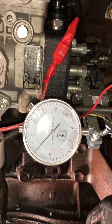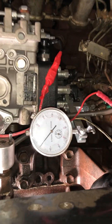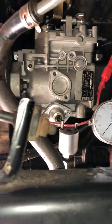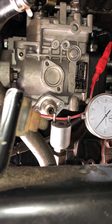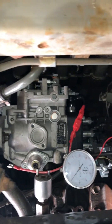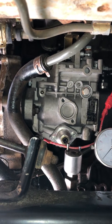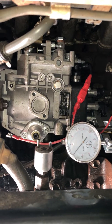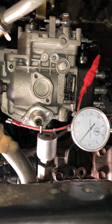So there you have it — just trying to clear up the confusion because I was very confused myself. Videos say top dead center but no one mentions bottom dead center, and it's actually bottom dead center when you're putting the belt on. That's when the little screws face straight up and down, at about 11 o'clock on the bottom pulley. When you're timing the pump — just putting a brand new pump on here — it goes the other way to top dead center. No idea in an engineering sense why top dead center ends up at about 9 o'clock instead of the actual upright top, but that's the way it is.